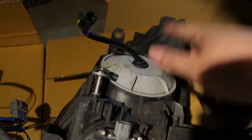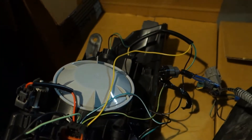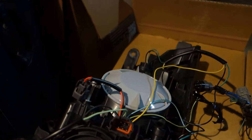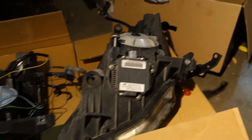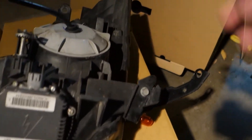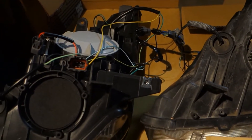This back plate I'm going to take off and throw the new one on — this is custom because of the igniter. I had to swap that over. But if you guys are staying stock, all you have to do is transfer the high beam bulb into this one right here. If there's already a bulb in there you don't have to swap it, but if not just swap the bulb over. That's really all it is. Also this bumper bracket mounts right here — let me get that on and remount the headlight back into the car and hook everything up.